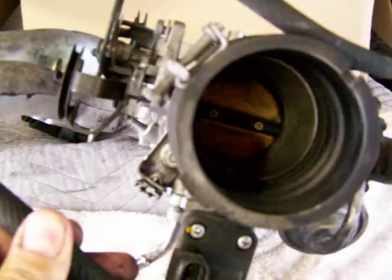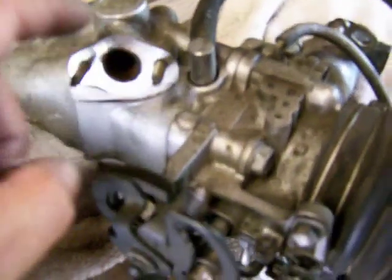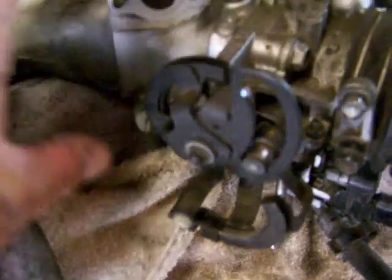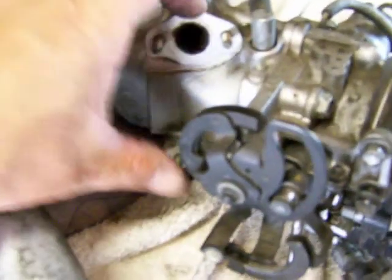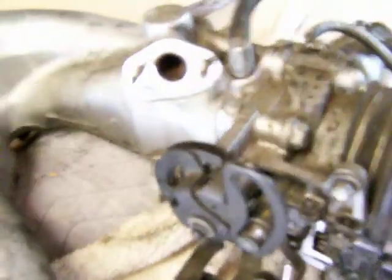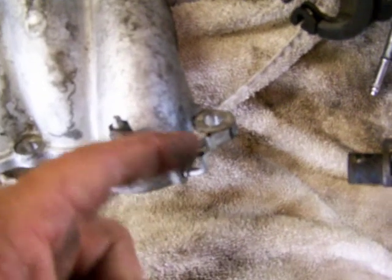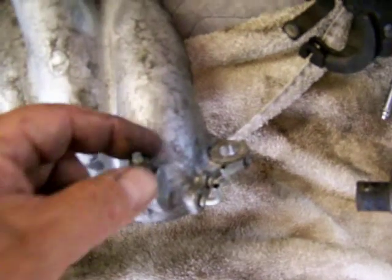I had to cut this one hose because it was hard as a rock. This wouldn't be a bad time to clean your throttle blade because it's probably going to be a little carboned up. This one isn't bad. You'll see that hole down there — that's for your idle air, which is something you can do after it's on the car. This is where your EGR hooks up to that pipe I showed you — you see the three studs. Two vacuum lines here — remove them from the metal pieces rather than the plastic.